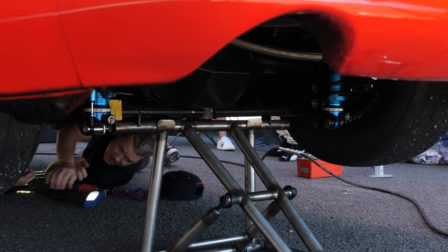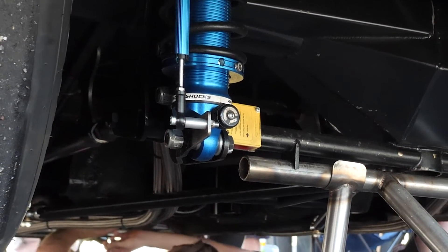With an IRS car, the way they need to transfer weight to make the car get out of the hole is a lot different to a live axle rear car. You'll often see the IRS cars hook and bog and the back of the car almost touches the ground, but with a live axle car, as the tyre hooks you see the diff sort of twist forward and the body actually lifts away from the diff — the body actually separates. So it's kind of opposite. You'll see that the shocks are actually upside down in the back of this thing. We stuck with the ladder bar — a single top and bottom linkage so you can adjust the angle. A lot simpler than a four link.